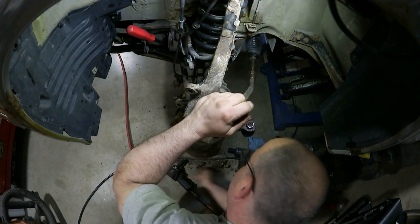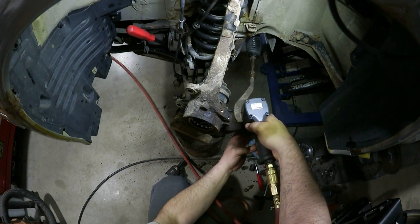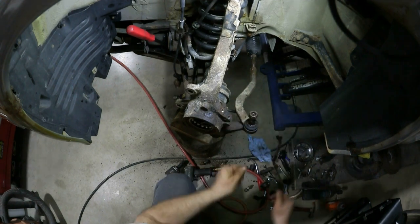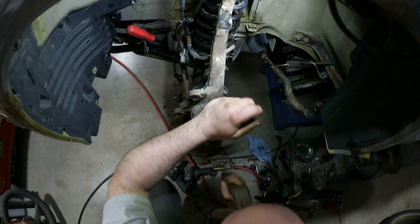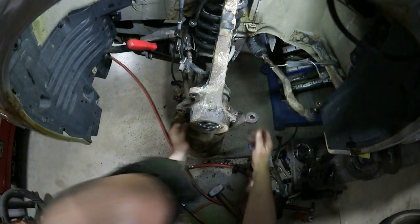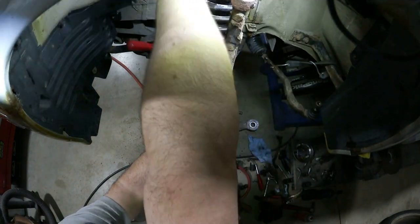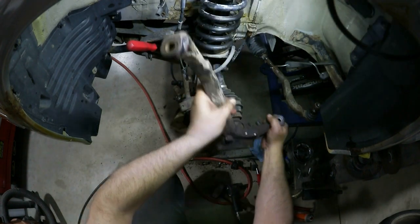Go. Now earlier that did not work, so I've got to think this coil helped. The tie rod end is taken care of. So now I'm going after the lower ball joint on the side connection. Okay, lower one's free. So I'm going to come back to the upper control arm nut. Take that back off. So now with the side one off, the top one off, and the tie rod end removed, this will just pull right out of here now.